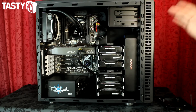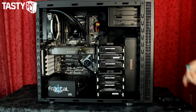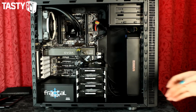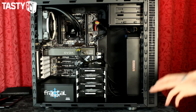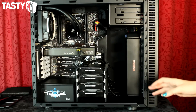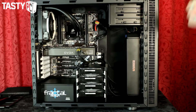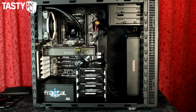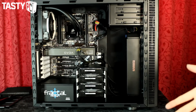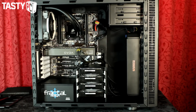This is a 240mm rad, although I'd probably use a 280 UT60 if I went with this option. My second idea involves having the hard drive cage in the middle. This hard drive cage is from the Fractal Design XLR2 and it allows me to fit four hard drives while being able to fit a monster rad in the front in push-pull. The monster rad is currently in the 350D so you'll have to visualize it. Doing this means I go down from 12 terabytes to 8 terabytes, though the two other hard drives can just go into Project Tasty so they'll still be used.